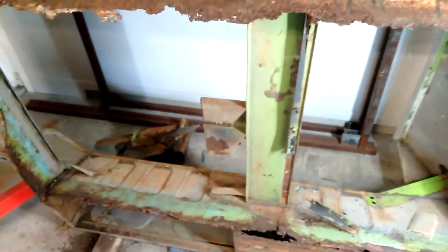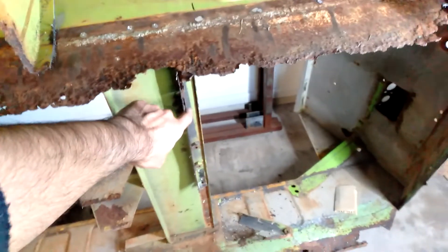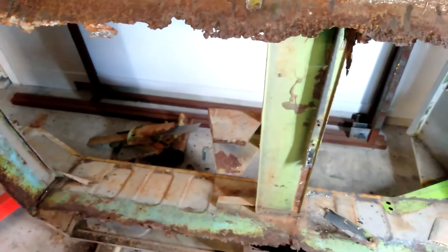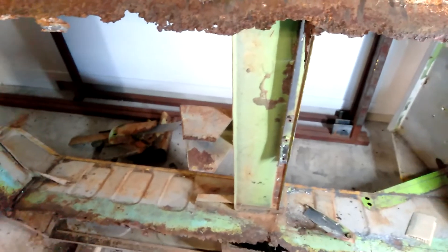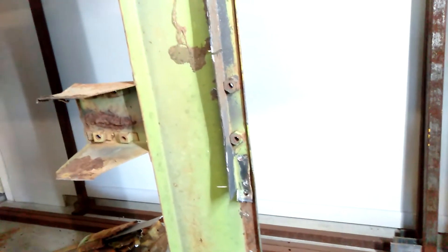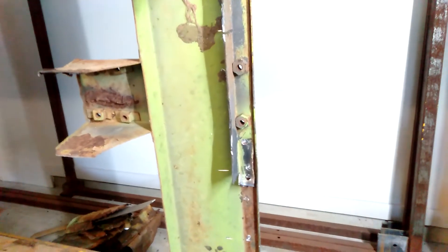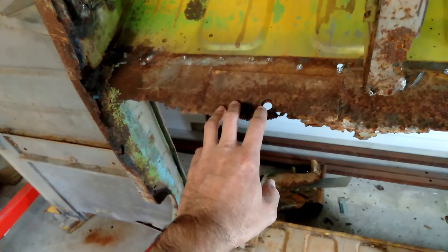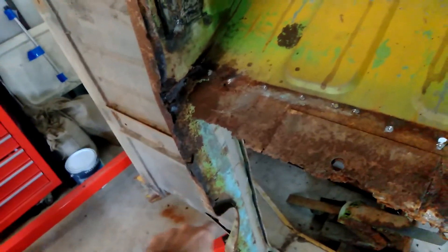I've started to remove the vertical panel off the cross member for the seats. It's very fiddly to try and find the spot welds because it's not always clear just by looking at the paintwork where they are. One technique I found useful was cutting as much of the vertical part out as you could, and then putting some angle grinder slits in there. You can move those bits and it will kind of reveal where the actual spot welds are. I've also cleaned up this corner a bit more - that's ready to have the parts cut out and replaced with new metal.